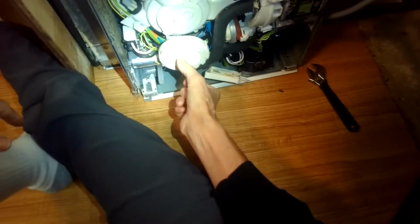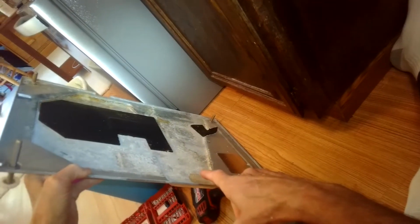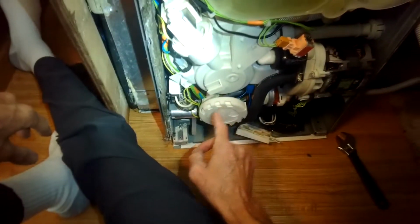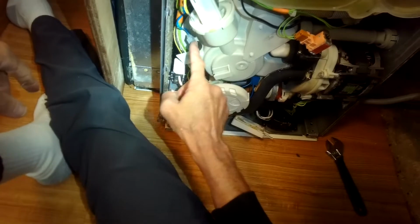All right, get that nice and tight. So just so you know some of the parts of the MIELE dishwasher, now that they're exposed here, this is the flap that moves up and down if water gets into the lower drip tray. It activates the anti-flood mechanism. And this is the connector to the temperature probe.